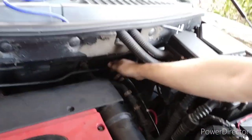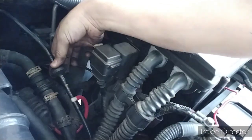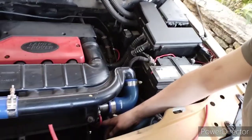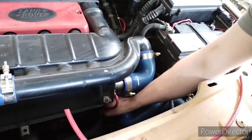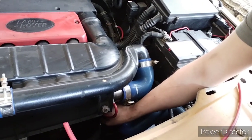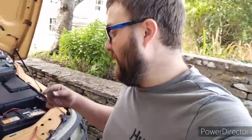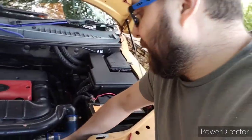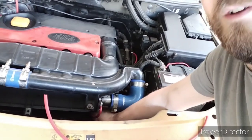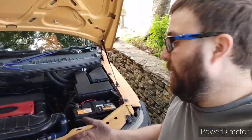When you're looking at the engine bay, you've got the bar that comes across for your brakes - it comes across and there's a little bypass valve looking bit, and there's your hose connector there where I'm tapping my finger. This one comes in underneath all of these pipes. Where the EGR hose goes in, just move slightly to the right and you'll feel where the end of the brake hose goes - it's just to the right-hand side. Make sure you do one at a time so you don't get those two confused. The EGR one is on the left on the driver's side, and the one for the brakes goes on the passenger side. Just follow that hose down and around and you'll feel where it ends.